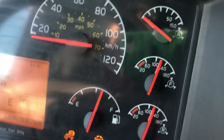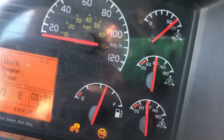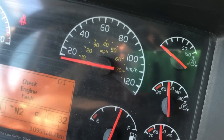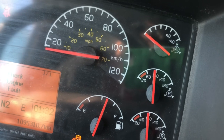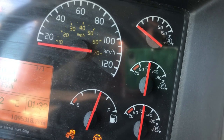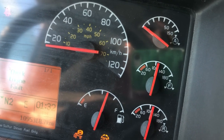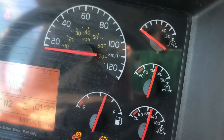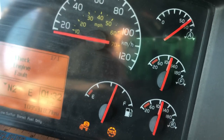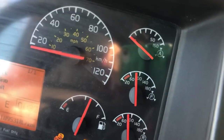We reached maximum pressure. Applying the first brake with my foot - still 90 PSI; second, still; third, still over 90 PSI. Letting the pressure build for the next application. That is four, five, and six. We have now adjusted our automatic slack adjusters.